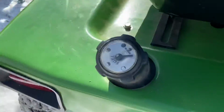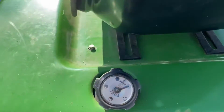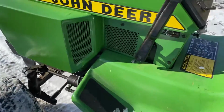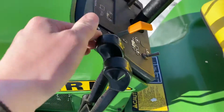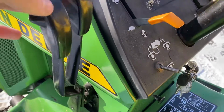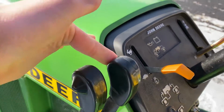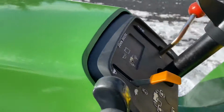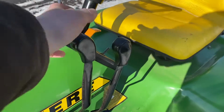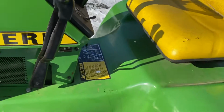And I did give it a new fuel cap, too, because the one that was on it was all broken off, and it was spurting fuel everywhere. And I fixed this lever. It was very stiff. It was just dirty down at the linkage down there. So whenever you'd push it backwards, you'd have to manually push it back, and now it'll just spring back on its own, which is what it should do. Same with forward. The float still works on it. This one still works. I just tested it the other day, so I hooked up the linkage right.